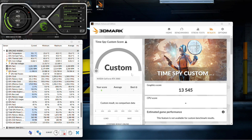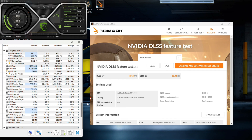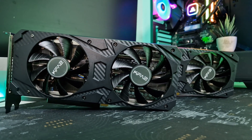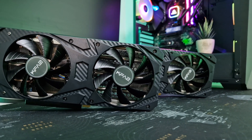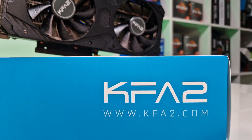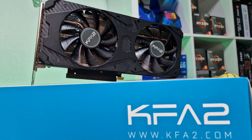Doing a rerun, we got 13,545 in 1080p and 8,899 points in 1440p, and DLSS gave us also about the same as stock. From here on, you could try to increase the core clock or VRAM clock and see if you could extract some more performance. I would suggest starting with VRAM first and maybe increasing the voltage by a bit in order to make it stable.